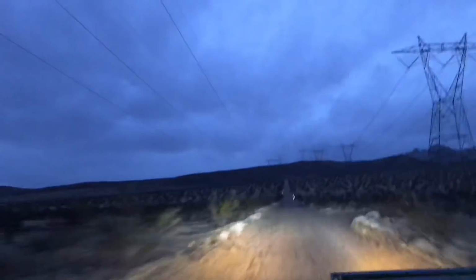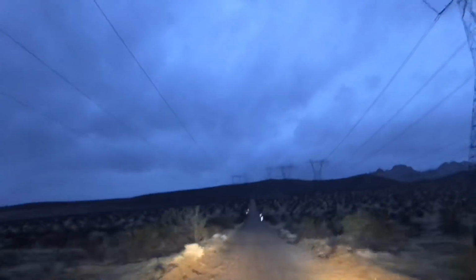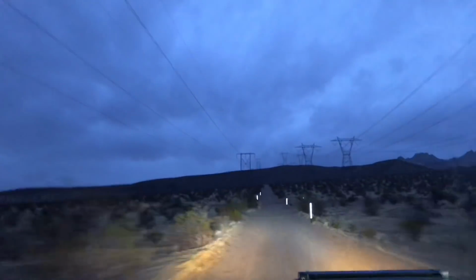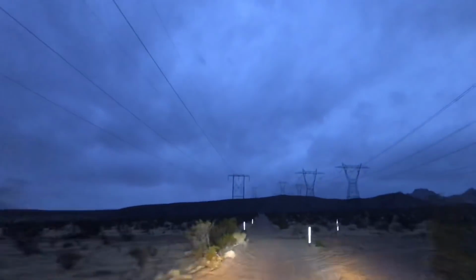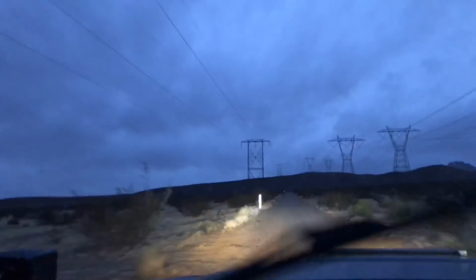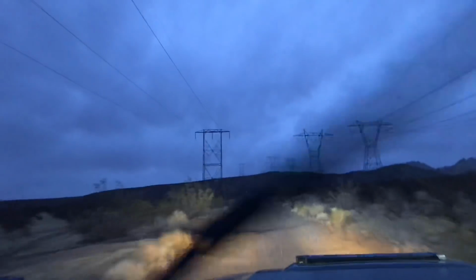And both the front and rear are right now factory valved and not really set up for the weight and application of my truck. So I'm excited to get things going with Ryan so that we can custom valve or performance valve the shocks and get them dialed for the way I drive and the way I've got my truck set up.